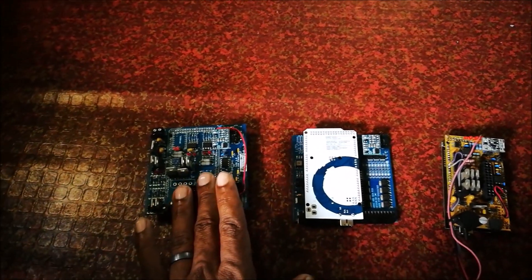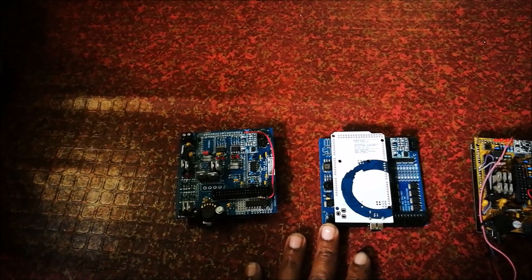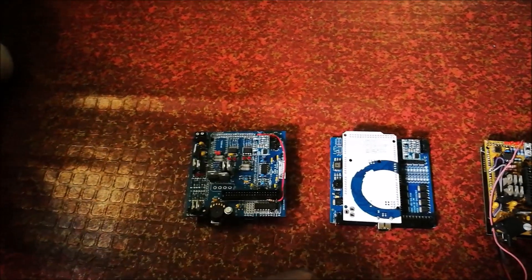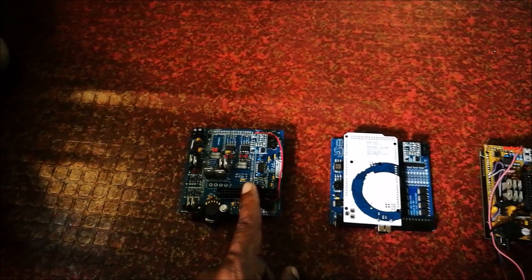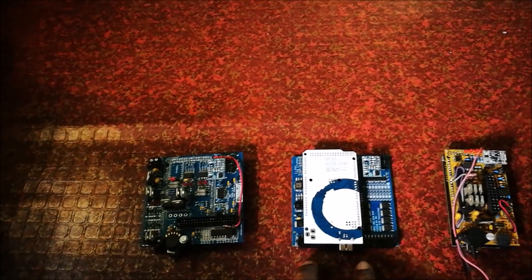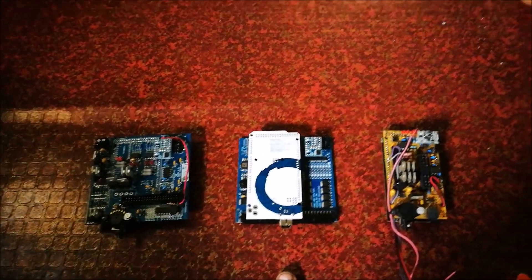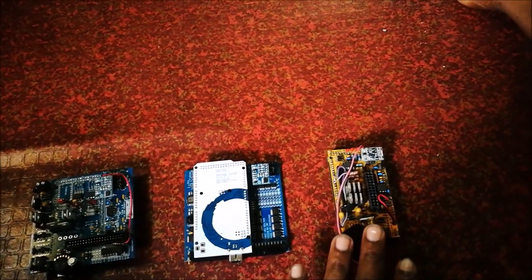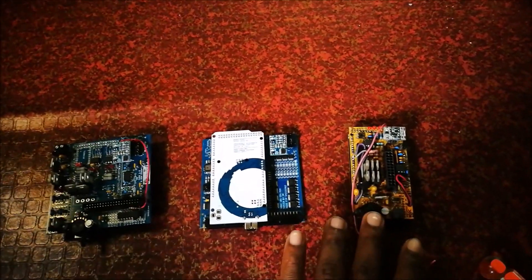If you're installing inside a factory ECU case — say a Honda — and want to gut the factory ECU and add something in there, the v0.4 (especially the v0.4.4) is probably better for you. You can also use it as a wiring ECU; I've done this on my Toyota Altezza. The UA4C I'd always recommend for fresh wiring installations or making a patch harness from there to your factory ECU harness. For complete rewiring, I'd recommend the UA4C. The NO2C I'd use for motorcycles or space-limited applications.